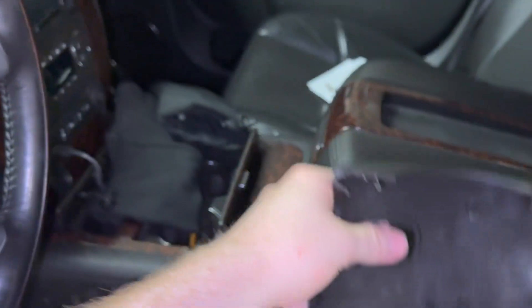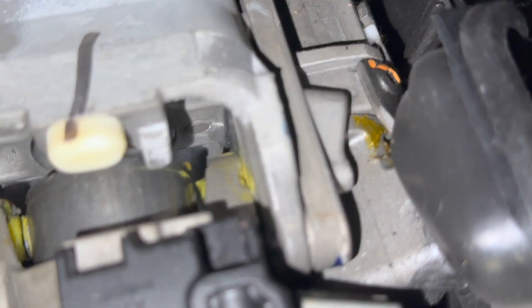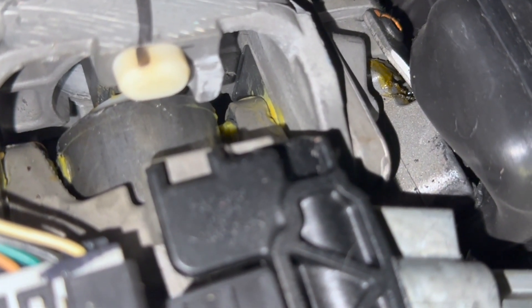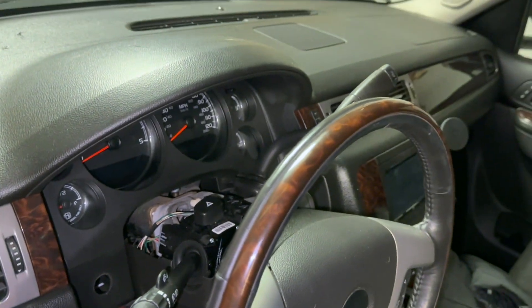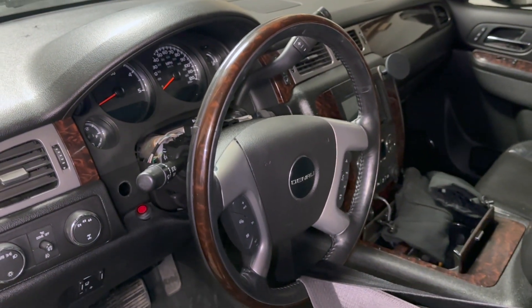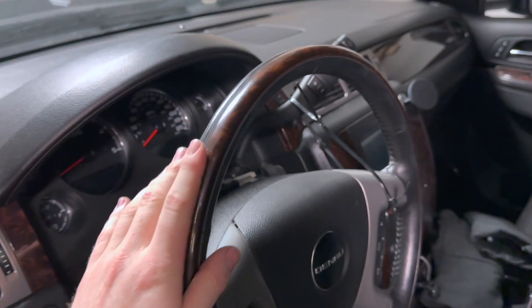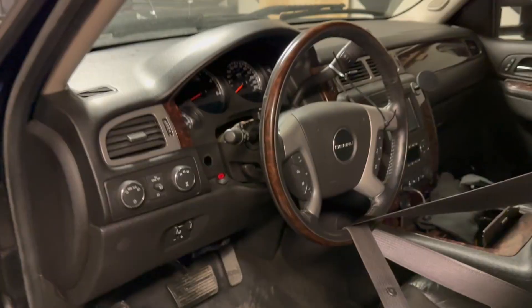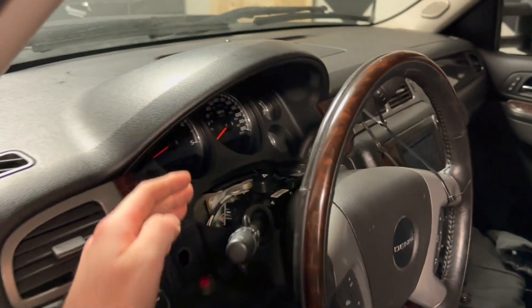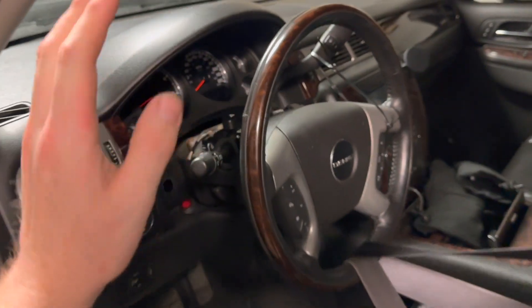What you also want to do is tighten up the bolts on the steering column — pop the cover off and there's a bolt on the left side and a complete opposite bolt on the other side, T25 torx bits. Tighten those up nice and snug — don't over-tighten because it locks into plastic — and that will reduce at least some play in your steering wheel. I also took some zip ties and locked the steering wheel in place as extra precaution so the clock spring won't fail.